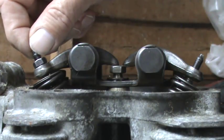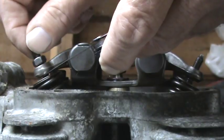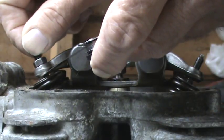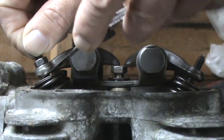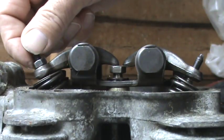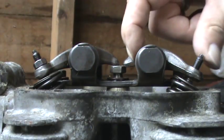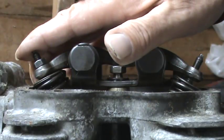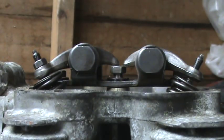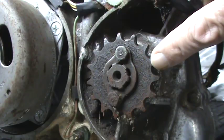And that's what I do. I've found that if I just get it to that nice slidey feel and then tighten up the lock nut, as I'm finishing off the lock nut it tends to tighten up that little bit and the nice sliding feel isn't there. That's why I just back it off that tiny bit and then tighten down the lock nut. Then hopefully job done — the tappet's adjusted, we've got the valve clearance correct, and all you need to do is put back on the valve cover, and if need be put a new gasket on as well. And while you've got the cover off, you might as well take advantage and check your gearbox bracket at the same time.